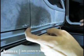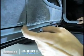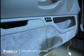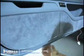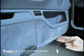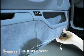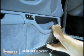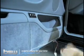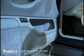There's a couple of other things I just wanted to show you guys in these 7s when you're pulling the door panels out. This plastic down here on this little door handle, I've seen this is pretty brittle, and these are oftentimes pretty loose in most of the cars, especially the older ones. So when you're doing this, be really careful with it. The way I like to start getting the doors off is with this light unhooked. You can get your hand down here, and I'll take my left hand and then my right hand and just a firm, steady pop, and you'll see all kinds of trash fall out of your door.